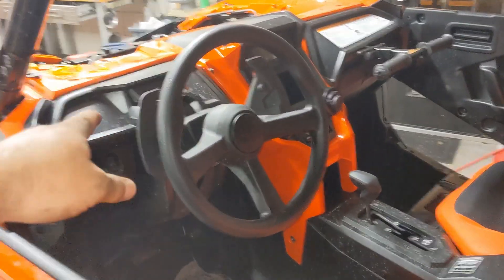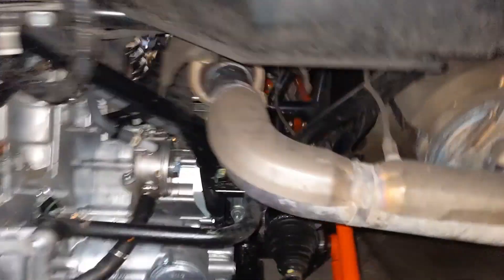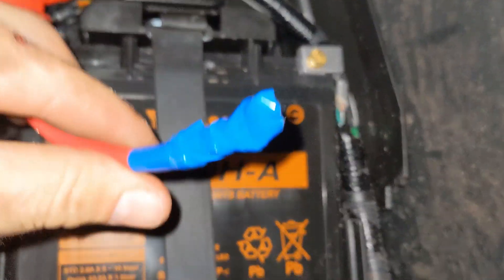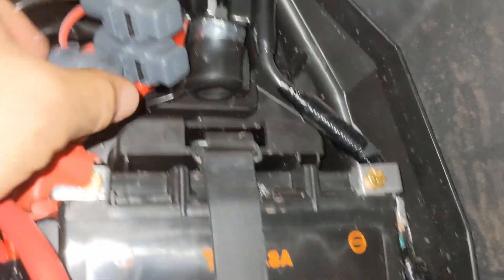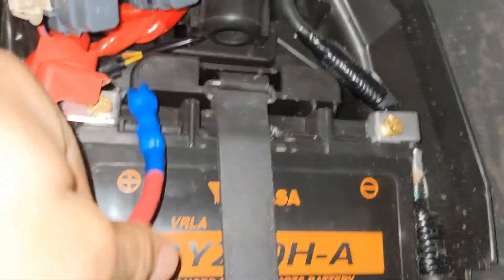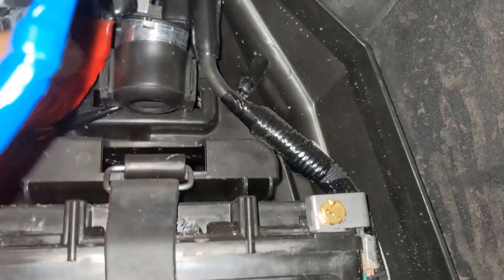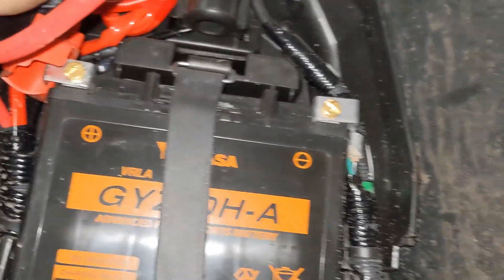You've also got to hook up the wire on the other end. Honda doesn't give you a five-gauge hot wire just sitting under the dash — that'd be a disaster. So you've got to hook it up to the battery side too. This wire is also wrapped in the same blue tape, tucked way back here behind your solenoid. To get it out you've got to pop off these 40 amp fuse holders, snake it out from behind there, hook it up to the battery. Take a razor blade, cut that blue tape off, hook up to your positive, and you're ready to start winching.